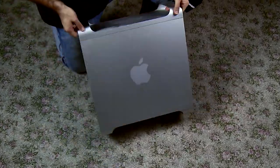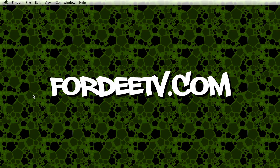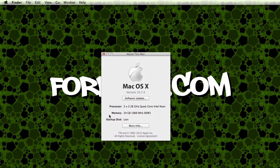And there you have it completed. Now that the computer's booted up, let's verify that OSX recognizes the memory we installed. Remember this computer had 8GB before we started this install. Go up to the Apple menu on the top left of your OS and select About This Mac. You'll see right here under memory it shows 24GB. 8 plus 16 is 24 so looks like we're good to go.